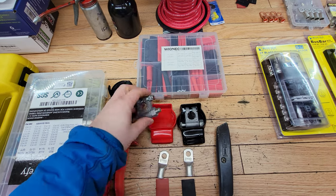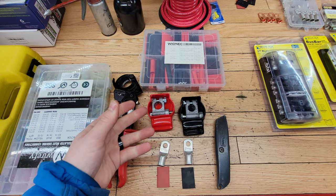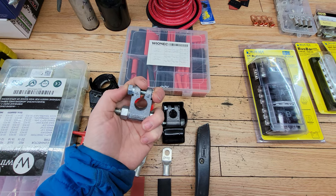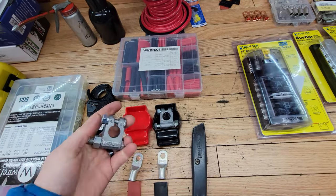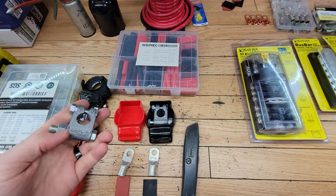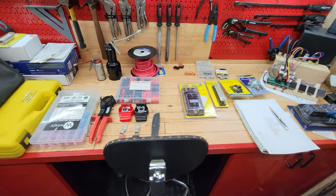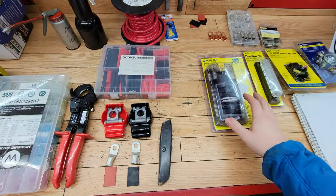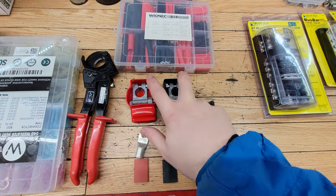The wires themselves will start to come apart from the terminals, exposing copper that will start to corrode. Another common issue is the tips of the terminals will start to break off from people clamping them on too hard. People will also start adding accessories and overload the current terminals, ending up with five or ten wires off the positive terminal. The goal today is to really neaten up the wiring by installing an auxiliary fuse box setup with both constant and switched fuse circuits. The prerequisite to that is upgrading the battery terminals themselves.